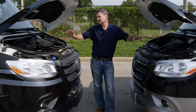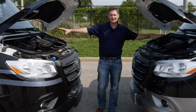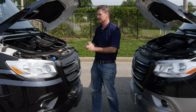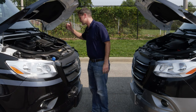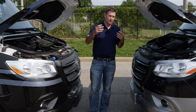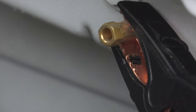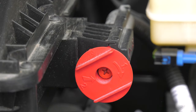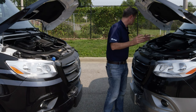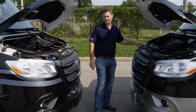Starting under the hood, you're getting the Mercedes-Benz V6 diesel engine, and this is where you're going to maintain your engine. You have to do all the maintenance laid out in your owner's manual. You have your airbox, access to all your fluids, you can check your oil, and when you need a jumpstart, there's a grounding post over here because the batteries are inside under the seat. You twist this knob and connect your red cable. You also have your DEF tank here — your diesel exhaust fluid.